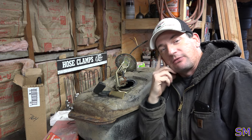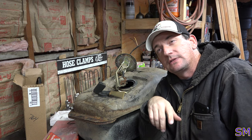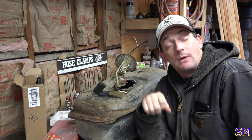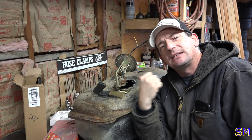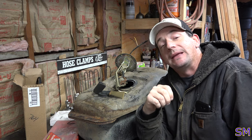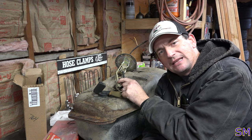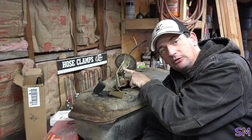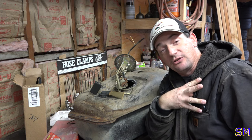This thing's only good for about 3 PSI. That Weber, I think we're going to be putting a 32/36, or 34/36, 38, I don't know. We'll be putting the Weber modification on it, and we realize this thing doesn't pump enough. That Weber needs 4 PSI regulated to run. So we're going to take this out, put just a simple pickup tube down here, and shove it back into the tank and back into the truck.